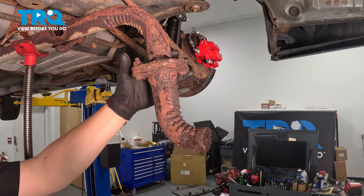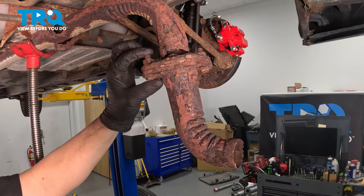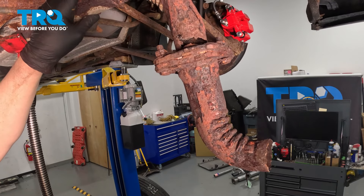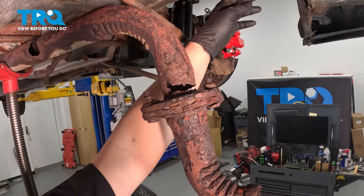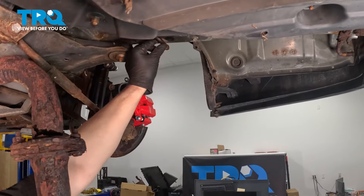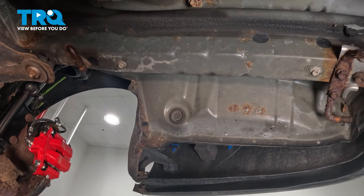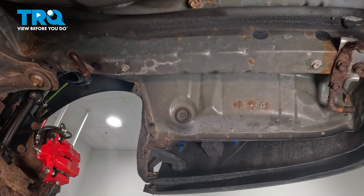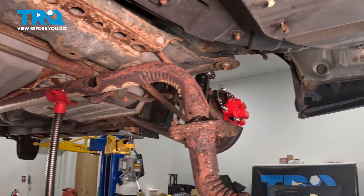If you're able to remove your muffler bolts and get a new gasket, you could just take out this middle section and leave the muffler in place. Our muffler is not connected. There should be three rubber hangers for the muffler on these three hooks. You can remove the whole system as one and put it out of the way, then put it back after. Ours is going to come out in pieces.